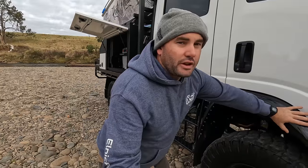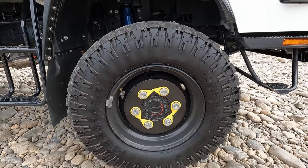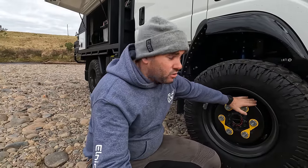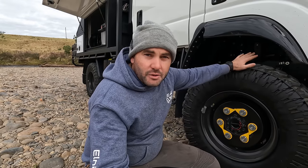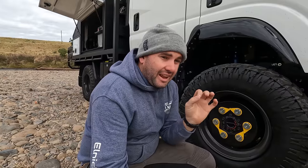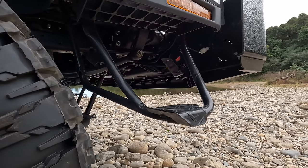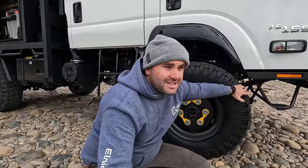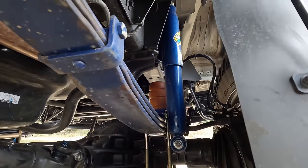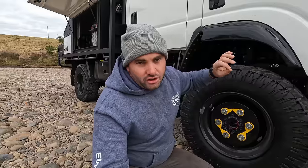The cab's pretty standard. They put flares on for the wider tyres. These tyres are a 305/70 R19.5 — Founders Mud Terrain tyre on a 19.5 inch super single rim from All Terrain Warriors. This tyre and rim setup lets us handle our full GVM of 7.5 tonnes and the full GCM of 11 tonnes — pretty big numbers for a tow vehicle. There's a modified front step because of the bigger tyres, and inside we've got ATW parabolic suspension with shocks. Smoother ride with just a rubber bump stop — we didn't go airbags, just something else to go wrong.